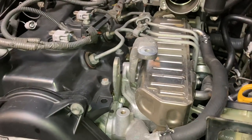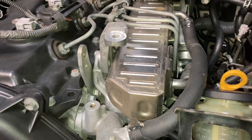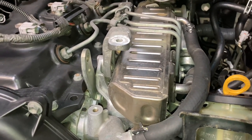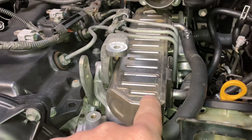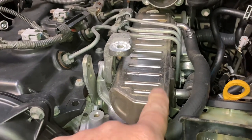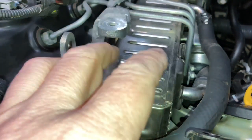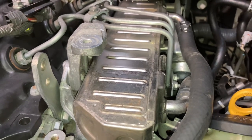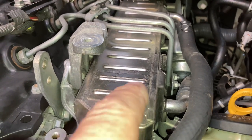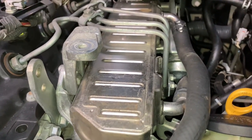Another really important thing I should talk about — these EGR coolers. One of our workshop partners has had two of them with internal leaks. It's something you really need to be careful of, because we've had one vehicle we just replaced an engine on that had an internal leak. That's the only one we know of directly — I've heard of maybe one or two more, but I can't confirm those 100%. This 100% from the client: he had an internal leak, it cooked the engine to 120-odd degrees. Now we've got a workshop partner that's had two with internal leaks, so we need to keep an eye out for that.